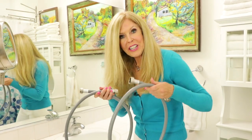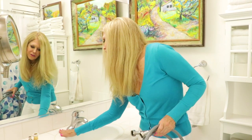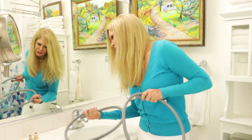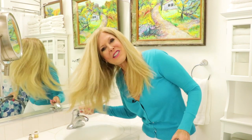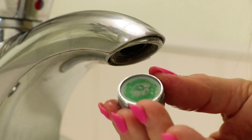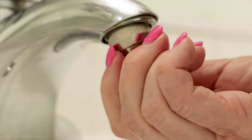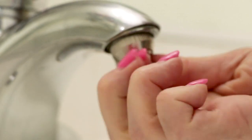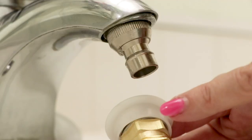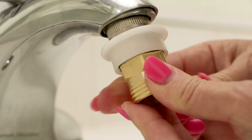The Comfy Washing Machine comes with two hoses for hot and cold. If my sink had a hot valve and a cold valve I would have hooked up one to each, but my sink has a single all-in-one valve. So to hook it up I take off the aerator and use Comfy's quick connect — feed that in and thread it right into my faucet. Really easy. Then take the brass connector that comes with the washing machine and it quick connects.